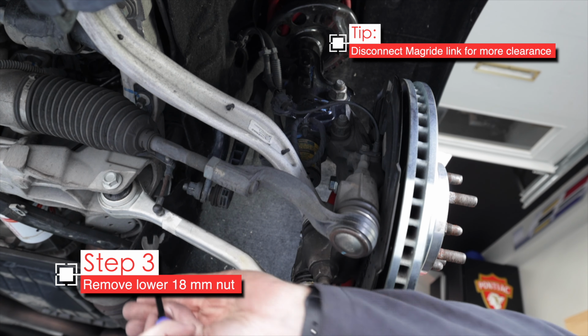Okay, now we need to torque this one. Let's get the old torque wrench. The torque setting is 74 foot-pounds. Oh, good, I moved the mag ride out of the way, and now we can torque it down. Yep, 74 foot-pounds, great. And then reattach your mag ride attachment point here. There we go. First I'll use the impact to see if I can get it on there mostly tight.